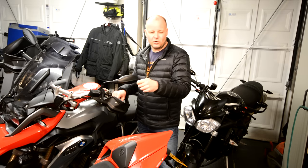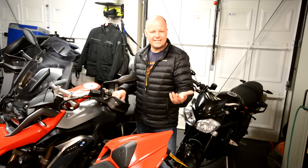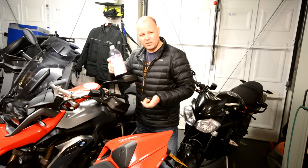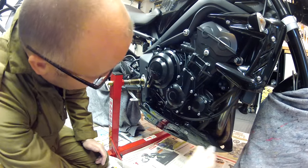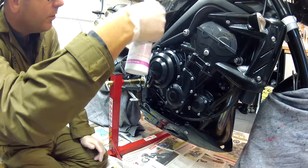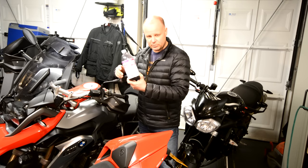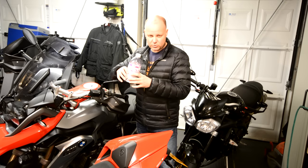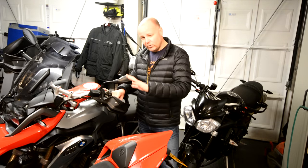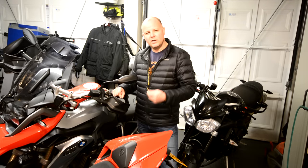One other thing I do — twice a year per bike through the winter — is add a protective coating of ACF 50. I've shown this before; I use it in these little bottles, and again I buy in bulk as it's quite expensive. Spray it on the bike once it's nice and clean, bring it indoors, and do that. I've got a video on how you do it and I'll put a link on this video. That just makes sure that if I get caught out in heavy rain on those greasy, salty roads, the bike is protected from corrosion. On the bikes I've had for some years, all the fasteners are still looking nice and shiny — so I think it's really worth doing.